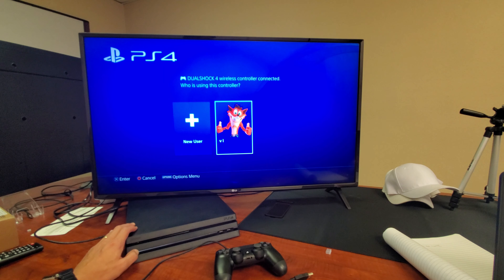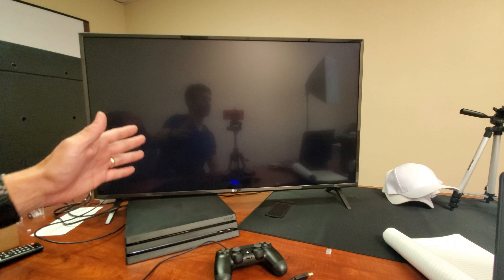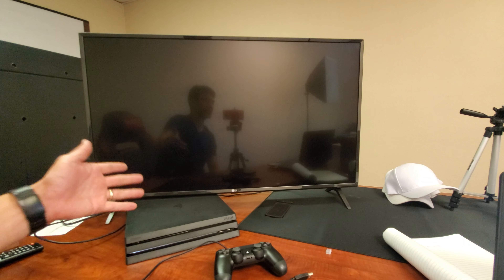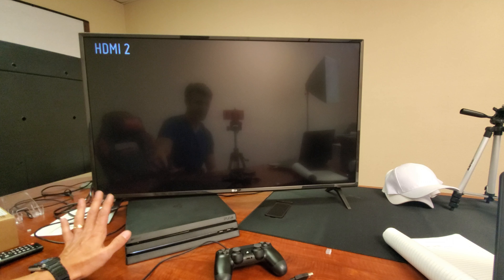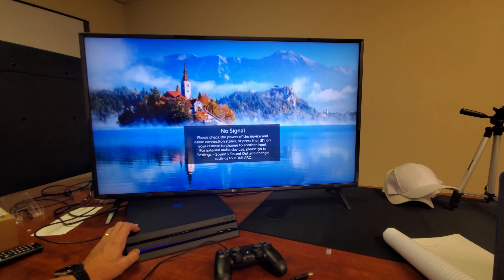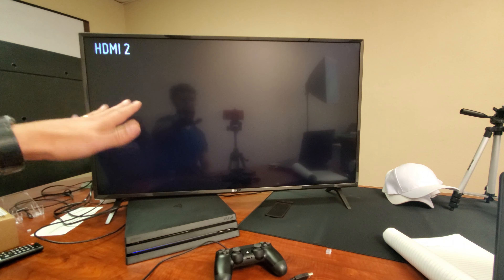There's one beep — wait for the second one — and there's the second beep. Now I can go ahead and let go. Before, when I used to do this it used to boot right into safe mode, but I think because I updated the PS4, now what this does is just shut it off. So now my PS4 is off. For some of you guys it may go right into safe mode. If it shuts off, do the same thing again: press and hold the power button until you hit the second beep. There's one beep — second beep is coming — there's the second beep, go ahead and let go, and wait. Sometimes this takes a minute.